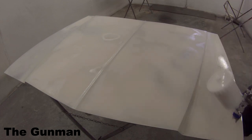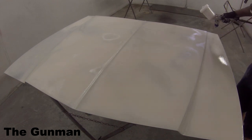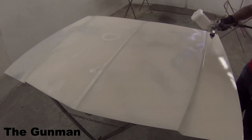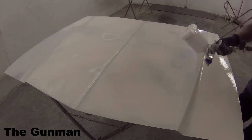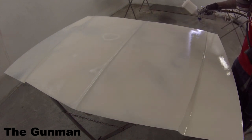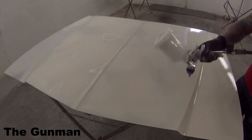It's got a 2.8mm hole. An average primer gun's 1.8 to 2.2mm, just for your standard primer fillers and automotive type stuff. You're not going to use this on an everyday job — there's no need. Sometimes maybe I should give this to the apprentices who put one or two coats on and walk away. Maybe this way they'd actually be getting enough primer on the jobs.